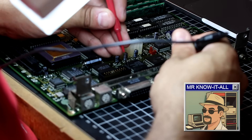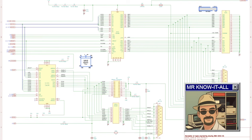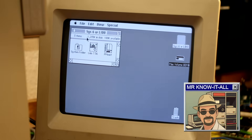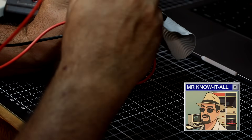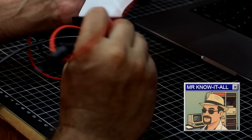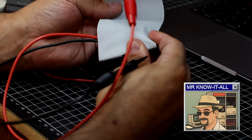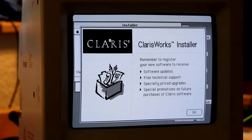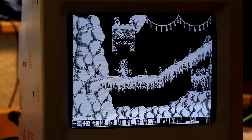After checking all connections using a helpful schematic for identifying the proper pins, I hooked up an external SCSI drive just to see what would happen — and that thing was in fact booting up. I then beeped through the internal SCSI cable. You can hear it: a broken wire in the ribbon cable. And with that being replaced, the machine was finally working once and for all, letting me install some software and run an extended session of Lemmings — for burn-in testing purposes, of course.